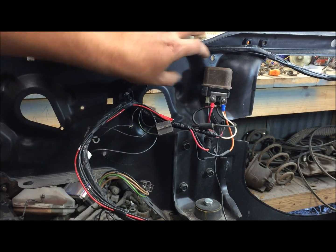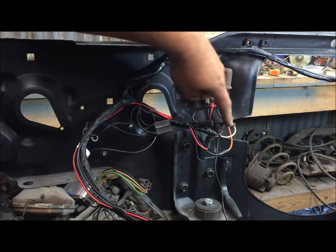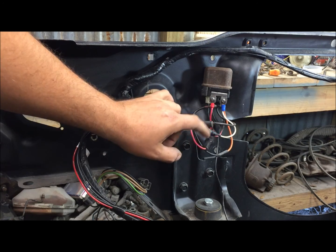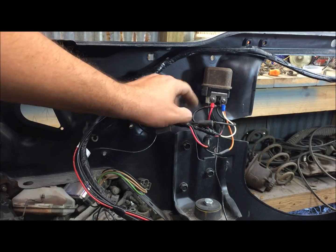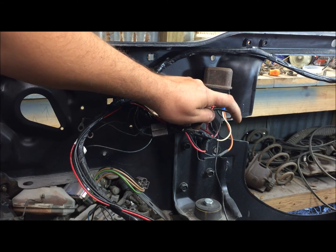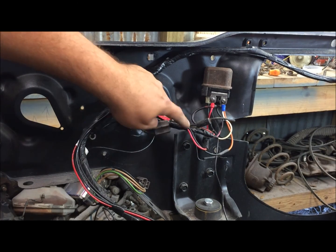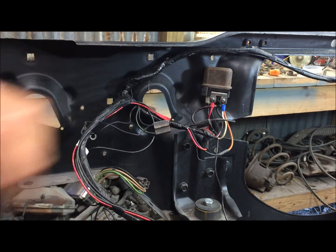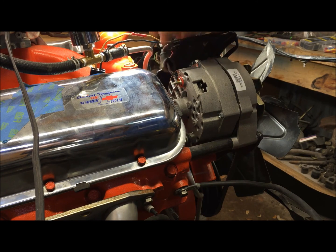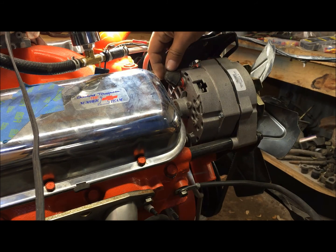Notice all the fuses. Just to better understand what's going on in this horn relay — this is the wire from the splice coming straight from the junction block. See how we have everything fused? This fused link is going back to the dash to power everything in there. This is my ignition box. This is a lead for the amp meter. They all have fuses on them. The only one that doesn't have a fuse in the conversion is this white wire — it comes straight from the number two position, the voltage sensing wire — that just needs to be connected back to hot. To keep it all in the harness, I just ran it back to the horn relay.